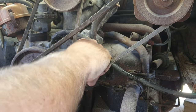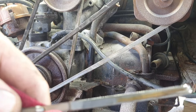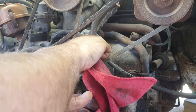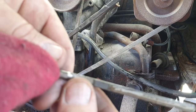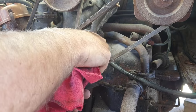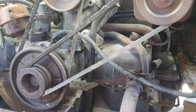Let's take a look at the oil. First look - all the dirt's on the bottom, but it looks pretty clean on top, right? What I think is I want to pull the oil out - because if you see it, it looks like it's overfull. Usually what happens is the water goes to the bottom and pushes the oil up. So it's always a good idea to take the oil out just to take a look. It looks overfull - that tells me possibly there's water in there.